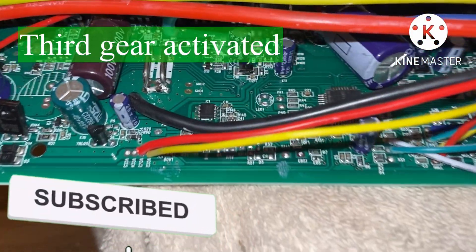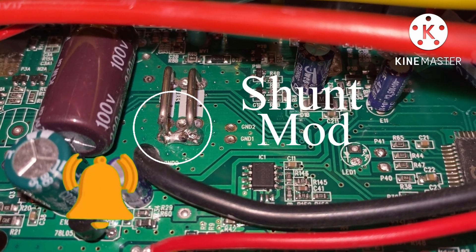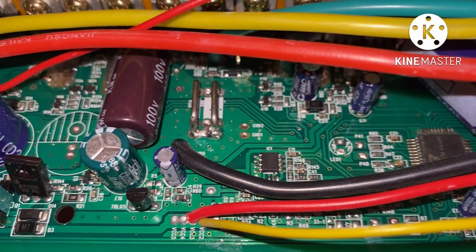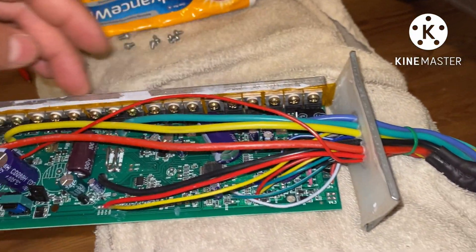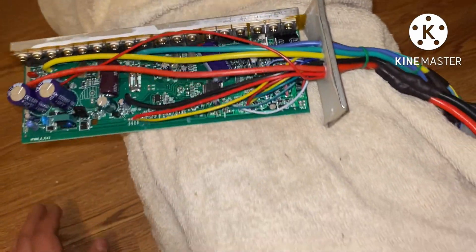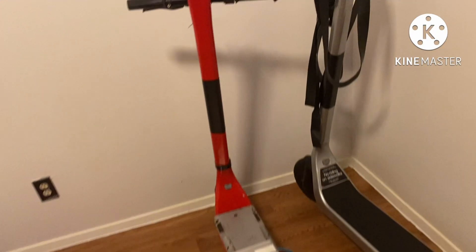I have my shunt mod done — that's what that looks like. Very small amount of solder, just got it bridged from the bottom, nothing too fancy. There goes my thermal paste — I'm gonna go ahead and add that to my heat sink, because as you can see there is hardly any thermal paste on there at all. I'm gonna go ahead and take care of that, close this up, and the modifications are done.